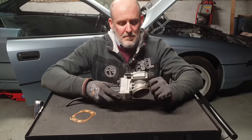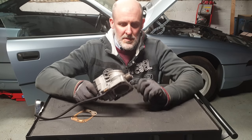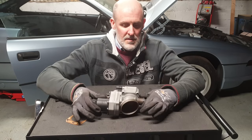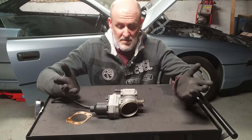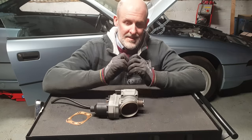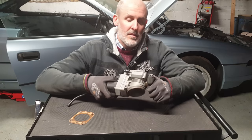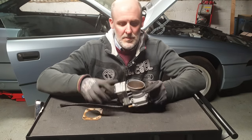This is one component of BMW's EML system, which basically originated around the time BMW was transitioning to a drive-by-wire system — no throttle linkage controlling the throttle bodies. With this V12, we have two throttle bodies. The EML system comprises both throttle bodies, the EML unit which sits behind the DMEs in the engine bay, and the accelerator pedal. When you depress the accelerator pedal, you're activating a potentiometer; that data is delivered to the EML control unit, processed, and then depending on parameters like engine speed and temperature, the throttle plate position is determined. These throttle bodies are essentially DC motors mounted straight onto a throttle plate.